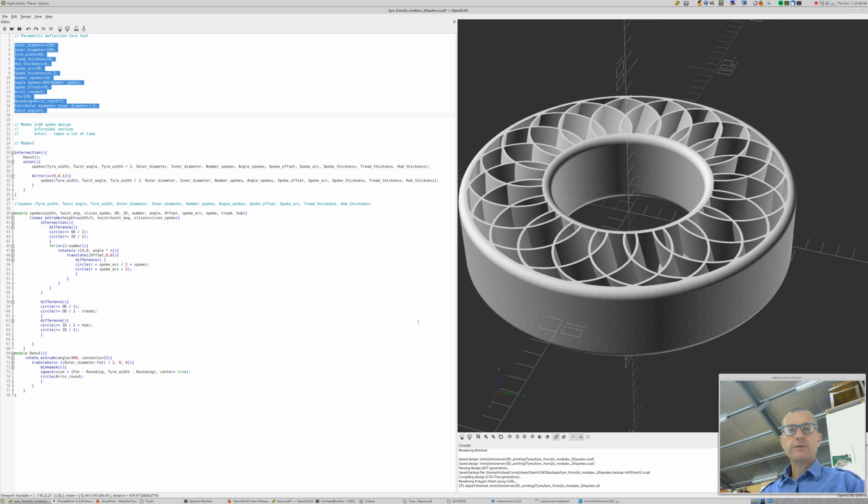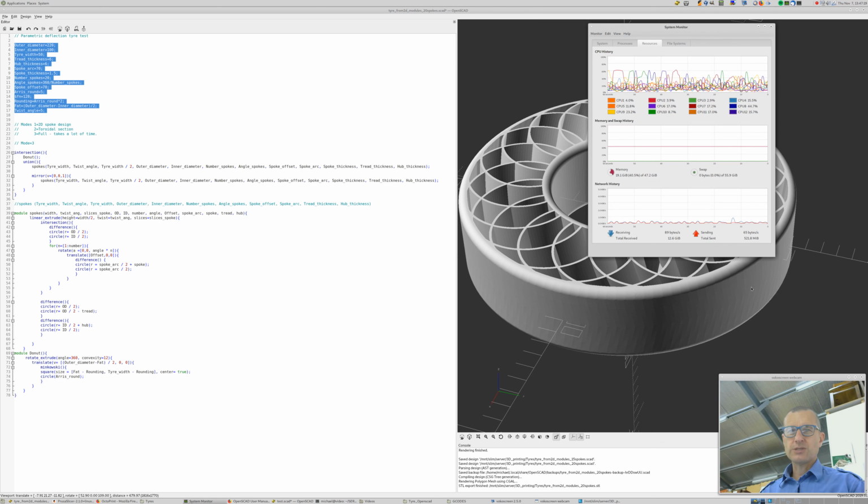I haven't enabled hyperthreading. It has 12 real cores and potentially 24 threads if I enable hyperthreading. I found for most tasks it's slightly better performance because there's enough cores by just leaving hyperthreading off. But some programs benefit from hyperthreading. So it depends what you're going to do. I will also give a small warning here. Do not do this on a laptop on a regular basis. You'll really shorten the life of your laptop.